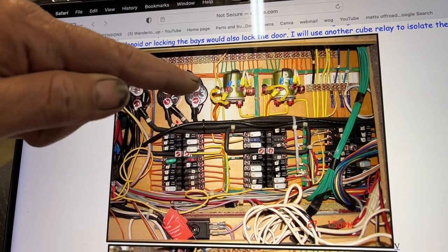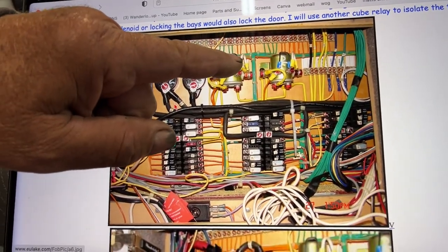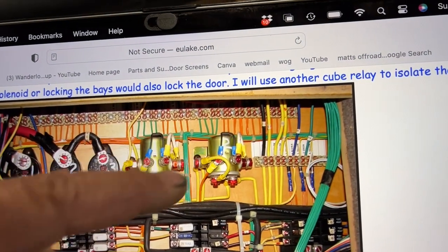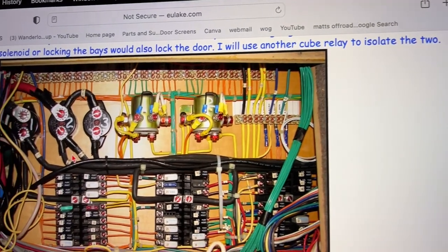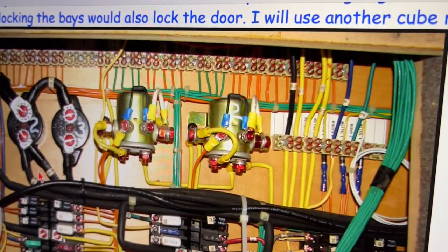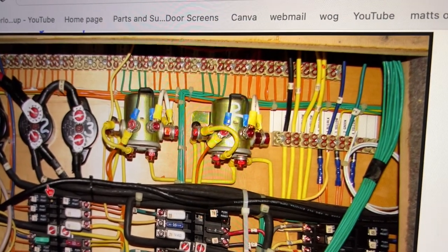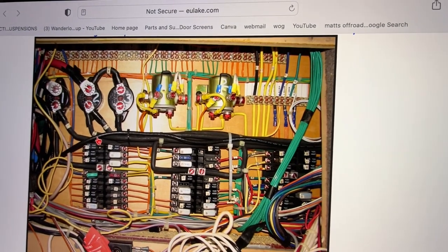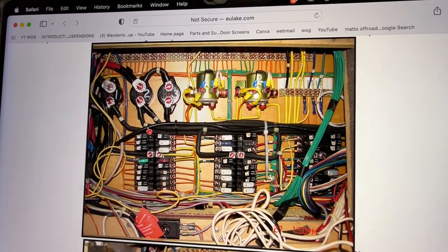So we're up in the overhead with a test light testing everything, and all that was working. But there was no ground. The ground is the white wires right here, and they jump from one to the other. But they also get buried in this harness behind the green and orange wire, and they go toward the entry door. We got in above the entry door, and when we were putting the Girard awning on, there was a wire in the way. There's a bus bar there, and this ground wire went to that bus bar. One of us unhooked that wire, unscrewed it from the bus bar, and tucked it out of the way to finish the Girard project — and we didn't hook it back up.